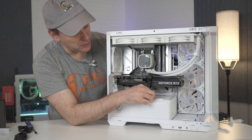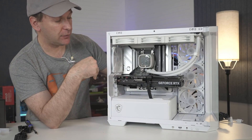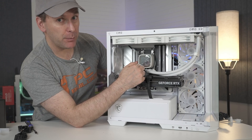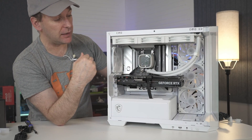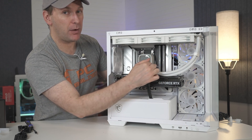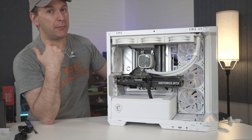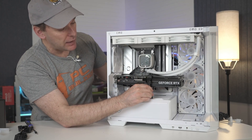It would be awesome to do truly no cable on the GPU. On the ASUS advanced BTF version, there is a connector on the bottom of the GPU that draws all power from the motherboard itself — but that only works with the advanced BTF board, not the basic version. You also have to buy the ASUS GPU that only has that bottom power connector, which means if you ever sell or repurpose it, it won't work with any other motherboard. So this is a bit of a compromise, but I actually think the cable looks pretty nice.